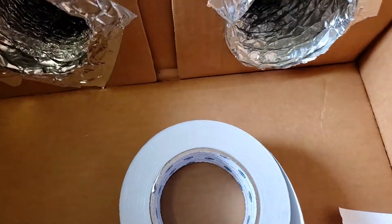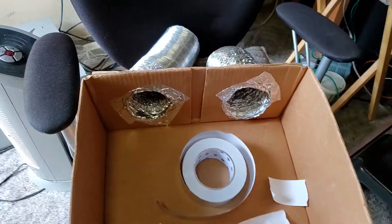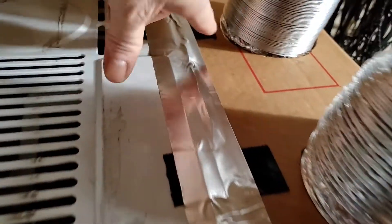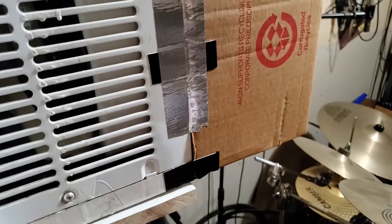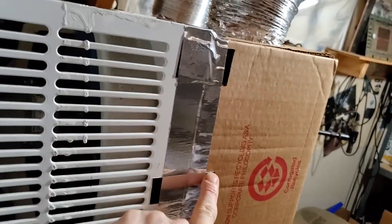I just wanted to show you — I rip off a small piece, about that long, wrap it around, and just keep piecing it all the way around. Now we're attaching the box to the air conditioner. These are done. I did a test — I put these on just to hold it in place first, then I turned it on, and it just blew out a lot of good air. I probably won't need it on high, but it'll work on high. It really pushes it out. So now I'm sealing it with the aluminum tape, because it's super easy to use. It's actually easier than duct tape, as long as you don't need the durability and extreme stickiness.